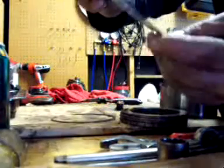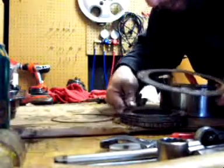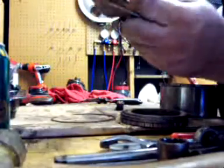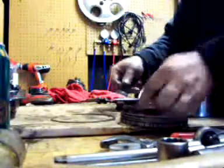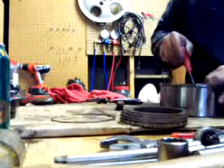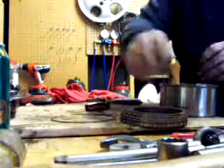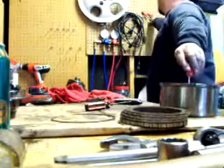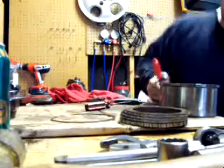One of the clutches does still have — I don't know if you can see it — the lines on them, the grooves. And the steels are relatively smooth; some still have some light scoring on them. So yeah, it was running pretty good. I seriously doubt those are the original clutches on that.